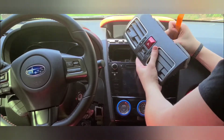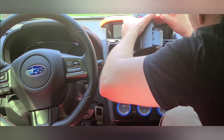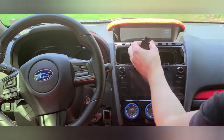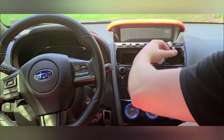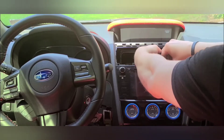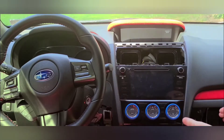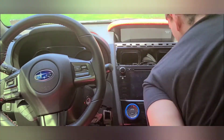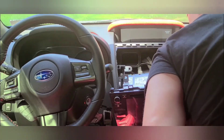One thing I can tell you is you don't have to remove the entire panel underneath the driver's side — I saw a couple of people do it that way, but it's way too much work. You literally just take out that Phillips screw on the left-hand side; that panel's enough to get to the bolt. The bolts on both sides are 10 millimeters and you will need extensions. I had a pretty difficult time getting my hands on the bolt. If you have a magnetic little tool to snag that, I highly recommend it — mine happened to break, so I had my wife get in there; she had really small hands and was able to get both sides.